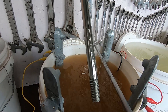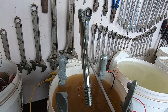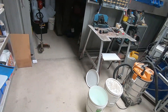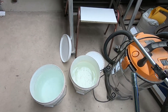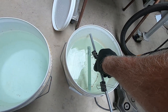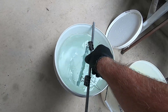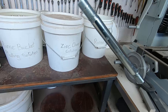Have a look at that! What we'll do now is rinse that and then dunk it in the zinc chromate to harden that zinc. We'll just rinse it off first, then take it down here and give it five seconds in the acid pickle — 1, 2, 3, 4, 5. We'll rinse the acid pickle off in some fresh water. Have a look at that — right, into the zinc chromate.